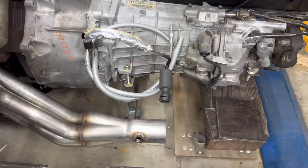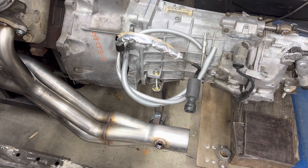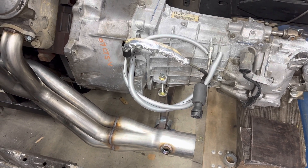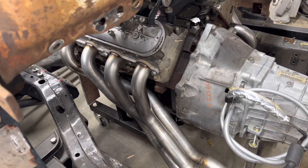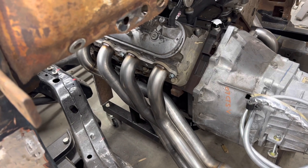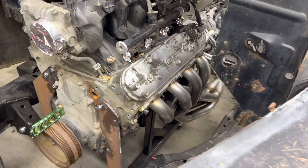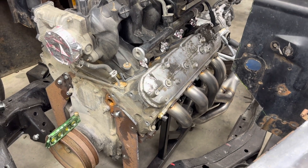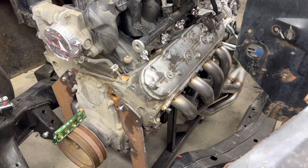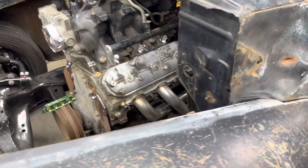I already made a little bracket bolted into the wings on both sides of the T-56. While it's not super sturdy, it should be sturdy enough once the front brackets are bolted in. I'm leaving the header in place for now, but once I'm building the engine mount I'll pull it out. I want to make sure the engine mount setup cooperates with the headers.